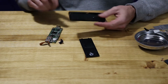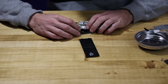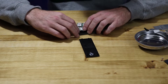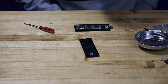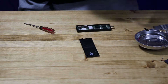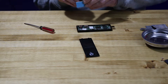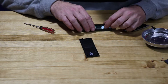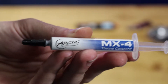We've got some holes here, so it obviously goes in one way. We've got to get the Wi-Fi and Bluetooth thing stuck back down in here. We had some thermal pad on that. I'm going to add a thermal pad to the memory chips, and that covers both. For the mini PC rebuild, we're going to use the MX4 Arctic Thermal Paste instead of the thermal pads.